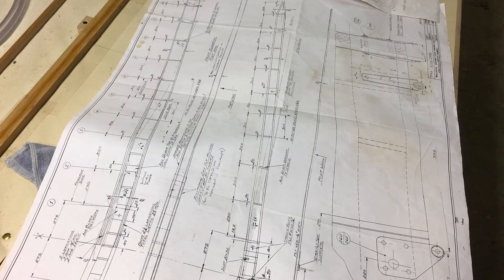Let's talk about wings. The Turbulent has an issue with its maximum all-up weight which can get a little bit marginal with a full fuel load and a pilot who is not at the lower end of the weight range. So it has been suggested that it would be a good idea to build the reinforced version of the main spar, which obviously adds a little bit of weight itself, but it gives a higher maximum takeoff weight overall so you have a bit more leeway for different pilots.